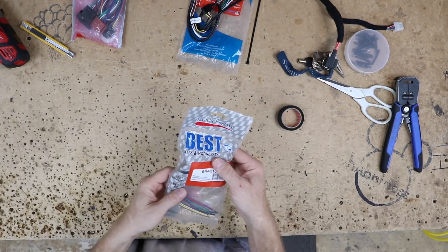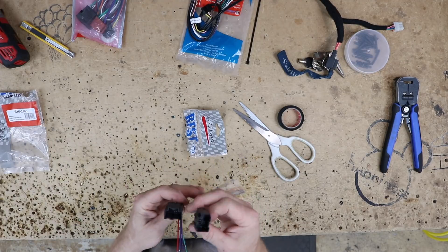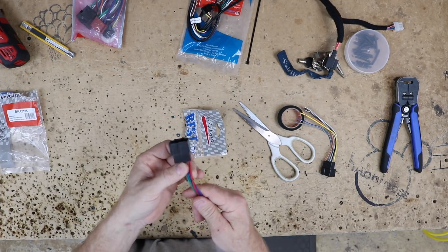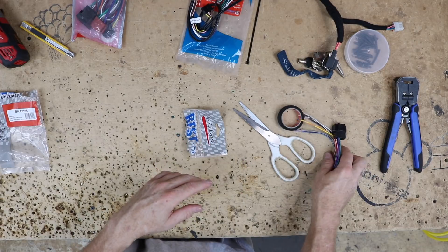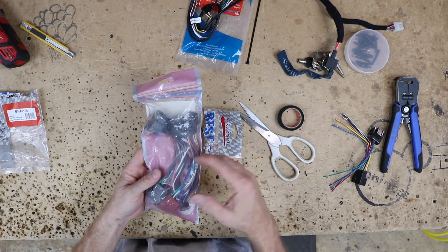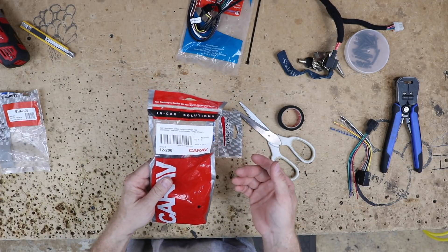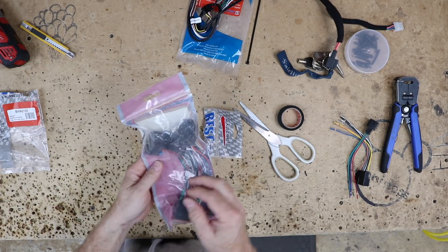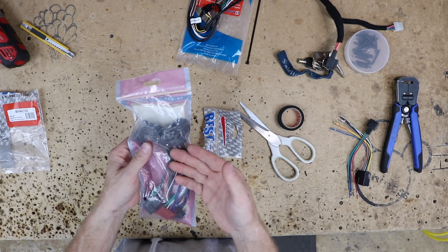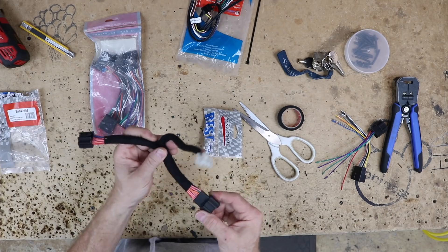For the sub and the rear speakers, a BHA 2105 pack harness should do the trick. There are two harnesses in that bag — one is the power harness, which isn't going to fit but has the color wires we want, and one is the rear speaker harness that we're going to re-pin. For the power harness, we need all 10 wires pinned. You could use the BHO version, but it's much easier to just order the 12206 CAR AV harness, which has both the male and female end — basically a T-harness. We actually already have one made up from our box of supplies.